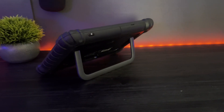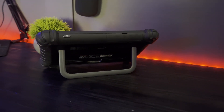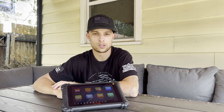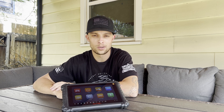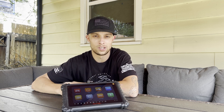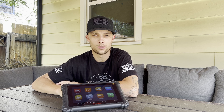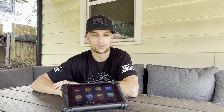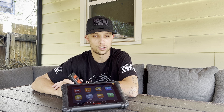As far as the TPMS side of it, the TPMS tool works great. I use it all the time for tire rotations on GM vehicles, where you have to relearn where all the sensors are. You basically plug the dongle into the car, it reads the VIN, you tell it you're doing a tire rotate, and it instructs you on what to do. As far as coding TPMS sensors programmed to the car, it's also straightforward — the tool knows what it's doing, makes it simple, and saves so much time.